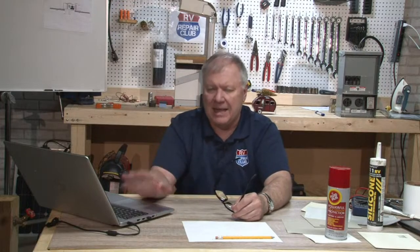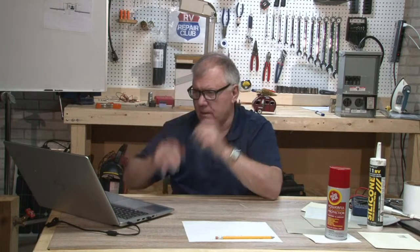outlet is ganged to other ones, that could be something too. It's got your one switch we talked about, or one connection, but it goes to this outlet, and then it goes to this outlet, then this outlet. So you do that, and now you're spreading that, and you're slicing all that available amperage up, and you're going to have a problem. And I would definitely not use this thing until you get that looked at, because you could have a fire. So that's something that's very important.